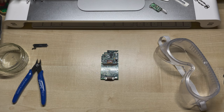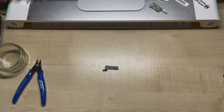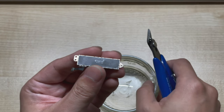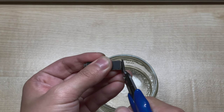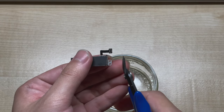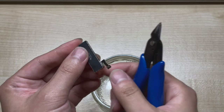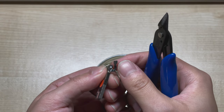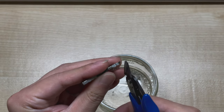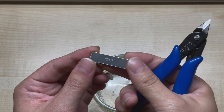With the board finally free we can now turn our attention to the Taptic Engine itself. Now as always make sure you're wearing eye protection for this bit. We're going to start off by removing these two tabs on the side with side cutters. Just grip them firmly but instead of cutting them, gently rock them back and forth until they come off — and again with the other side. We won't be using this ribbon cable here because we'll be soldering directly to a diagnostics pad, so we can remove that too. And now the Taptic Engine is ready to go.